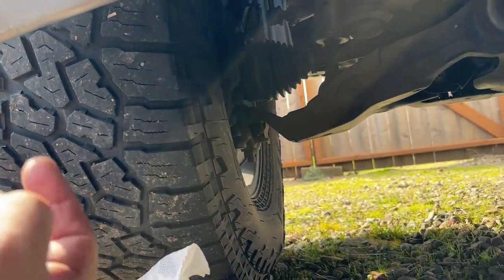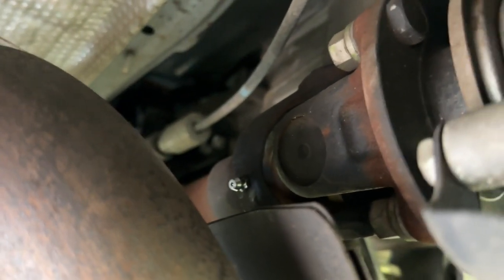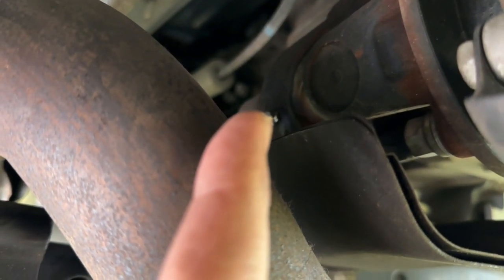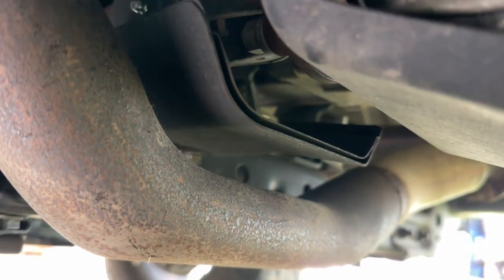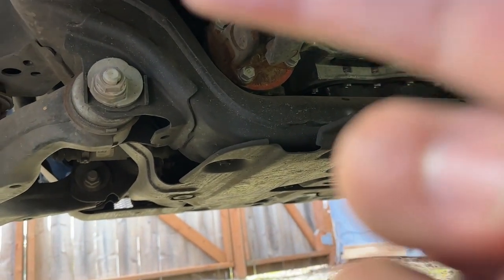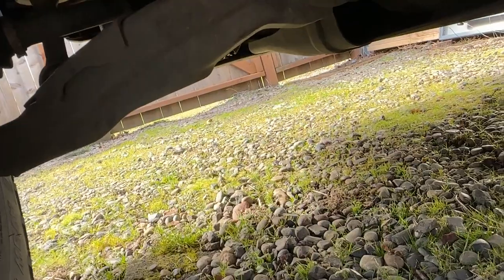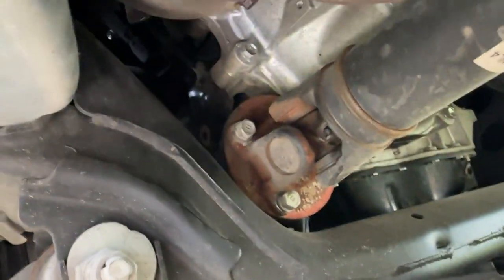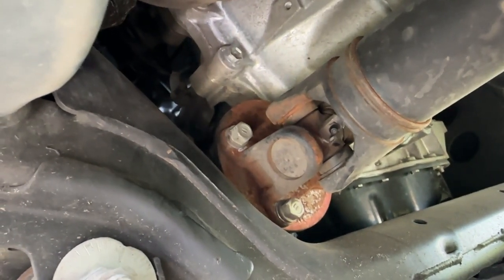Moving to the front — we're under the driver's door on the driver's side. We've moved from the back of the transfer case to the front. That zerk right there is for the front driveline, and the u-joint zerk is in there. Going to hit these quickly and then there's one more. I'm really contorted under here but need to roll it a little bit to get to the u-joint off the transfer case. The front driveline zerk is lined up — hitting that one, then one last one back there which just needs the driveline rotated slightly.